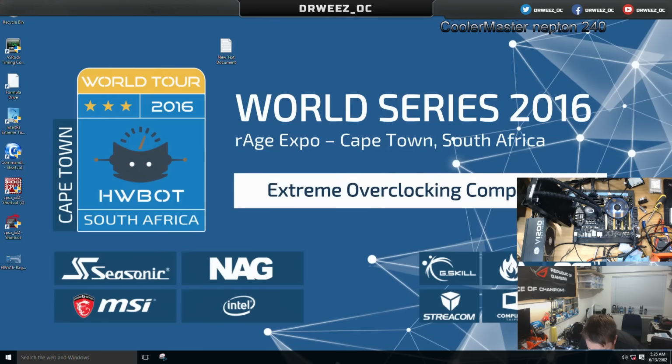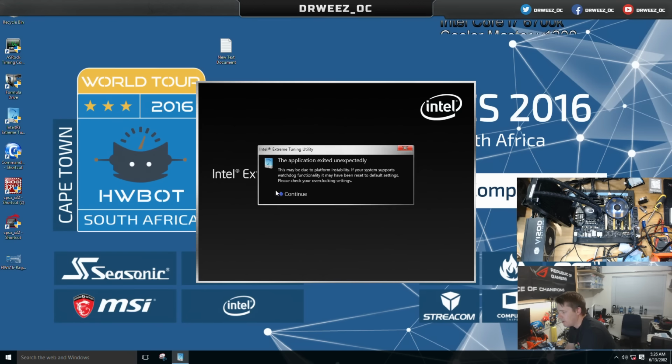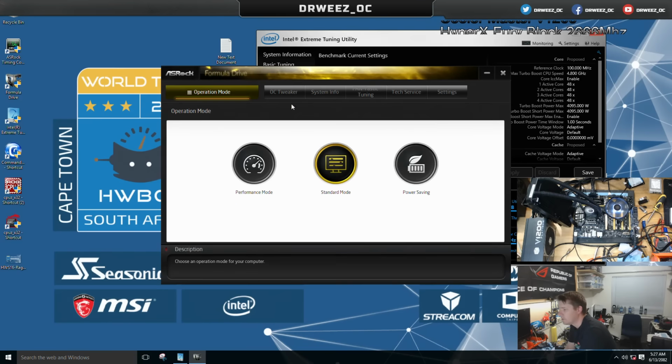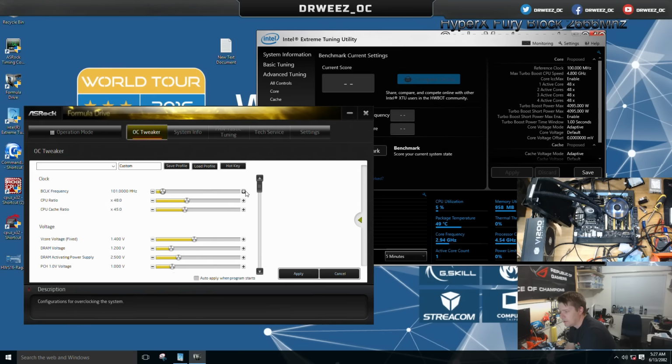The question has been asked as to what CPU I'm using by a guy using Droid Insanity. I'm using the 6700K, the Core i7 CPU. Currently it is clocked to 4.8, and we're going to try and run 4.9 with a little bit more voltage. I hope you were watching, my temperatures were jumping up to the 80s on that last run, so we might be hitting the thermal voltage barrier.